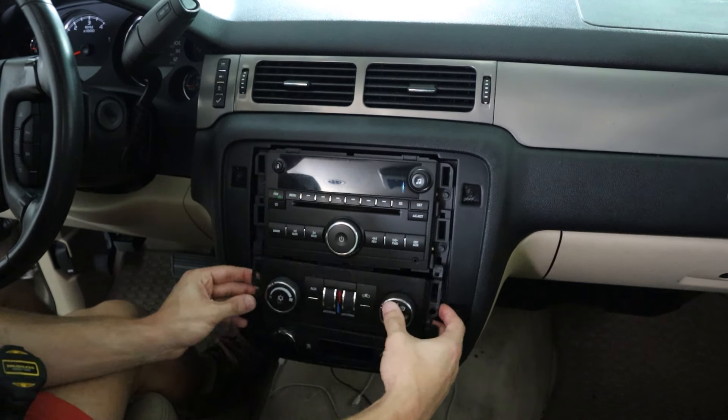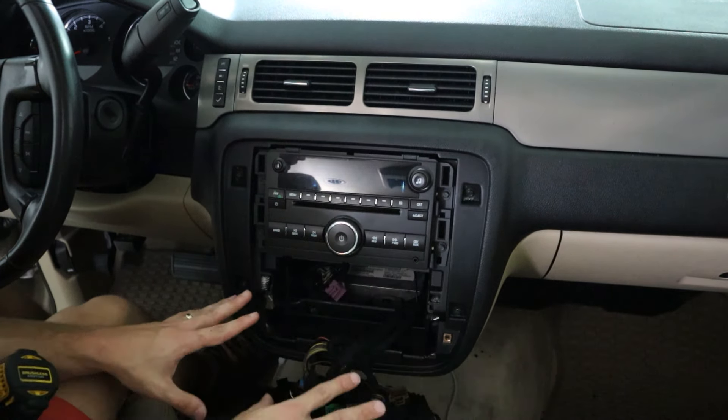Follow along this side. It's actually four clips on both sides. Go ahead and grab a seven millimeter. There are usually two more bolts here, though this dash has been cracking a lot through the years. Just pull this out — you can hang them there. Four more bolts here and here, then pull this right out.